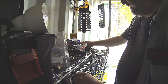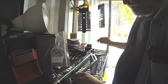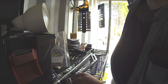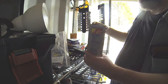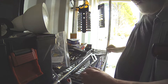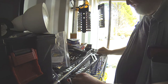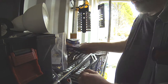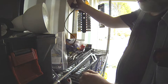Got to find a way to turn the engine over so we can get the points to open so I can check the gap. All the other stuff — it's going to be the wiring more than these parts. I didn't buy any plug wires, although I do have other sets. This is probably a set of six, unfortunately — probably for the Valiant. Anyway, I do have other wires if we need them, but I'm going to leave those for now. The plug wires are probably the oldest thing on that engine, but I don't believe that's the issue. Even if one or two of those was bad, the engine was supposed to start. So I might use the remote starter switch rather than having to be right on that side of the car — you can be a little more remote with it.